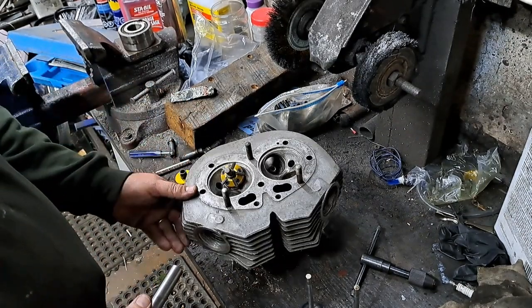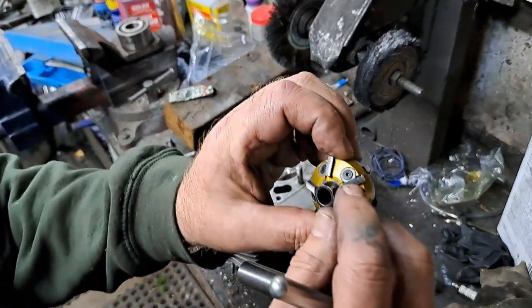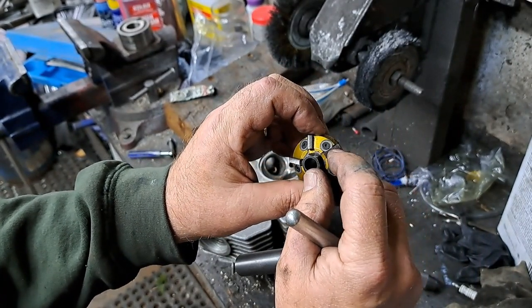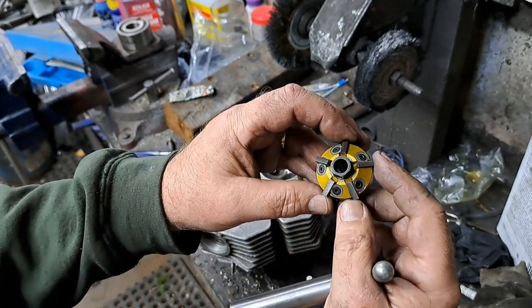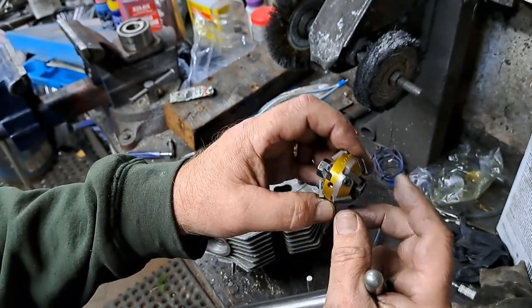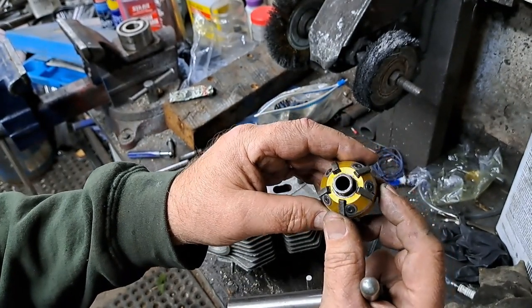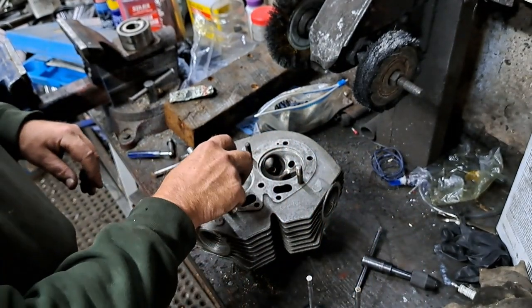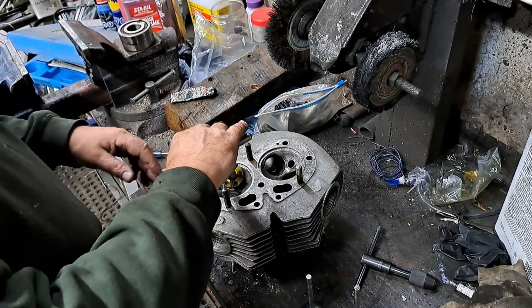Anyhow, all you do is slip that cutter on over the guides. You can see there's these little file-shaped cutters on here, and you can actually move them in and out depending on the size of the valve seat that you're cutting. But again, like the reamer, don't turn them backwards. You will dull the teeth. And you can replace those cutters if you need to.